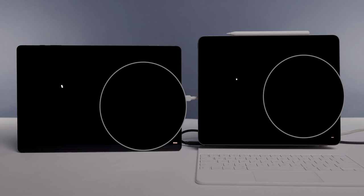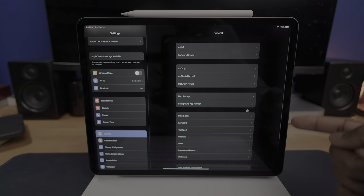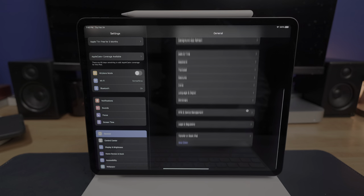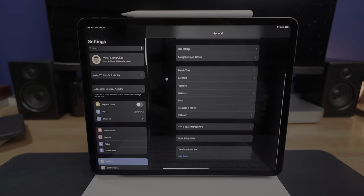This is the standard HDR local dimming blooming test, and this is where the iPad Pro gets pretty much obliterated by the Tab S8 Ultra. The mini LED panel is very susceptible to bad blooming, especially when you've got super bright white text surrounded by black. I hadn't used this iPad Pro 12.9 extensively until getting the Tab S8 Ultra, and I have to say the blooming is a little worse than I thought. It's not just for tests like this — generally when using the UI, dealing with not-quite-completely-black levels, the bluish blacks in the settings menu in iOS, the blooming is pretty bad when viewing at certain angles. I do wonder if Apple thought this mini LED display was worth including despite the cost of noticeable blooming.